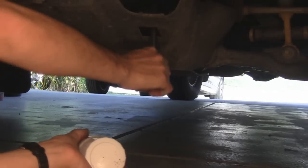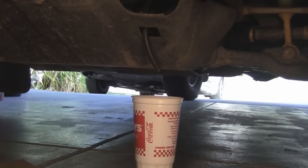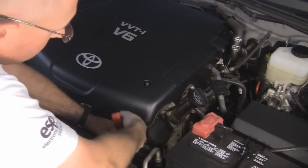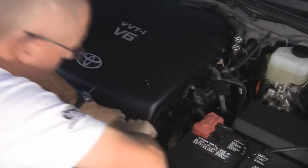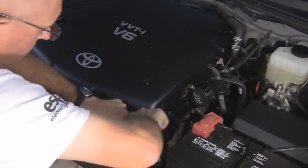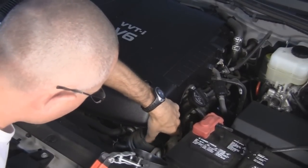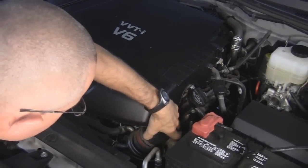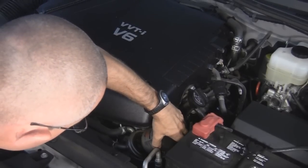Down in front of the truck I just routed the hose through this hole in the splash guard. I'm just going to put a little cuff there like that — that will catch the oil. Now we remove the oil filter. The oil is starting to drain into that little tub. There it goes.